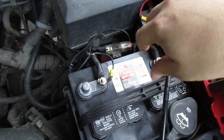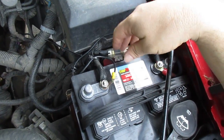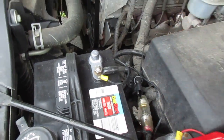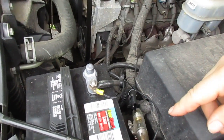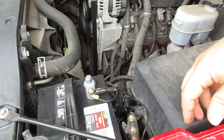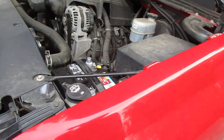This battery is mounted in the factory battery box that comes with standard GM full-size trucks — your model may vary. You do have to take a little block to tie down the battery, available at your local Chevy parts store, and a bolt is needed to tie it down. You can use a standard hardware bolt — I think it's an M8. They say you need a quarter-inch by one-and-a-quarter bolt, but I find an inch-and-a-half bolt works.